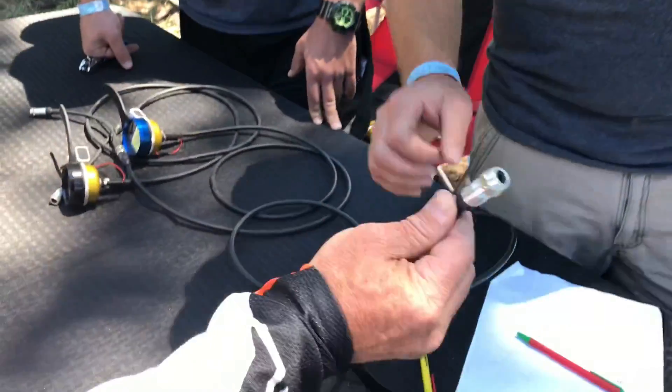The temperatures just skyrocket and you won't make it home. A lot of people can stop there and do a quick belt change — you're not pulling strands out of your clutch. Hopefully you didn't do engine damage when your belt broke, or clutch cover damage. We see that a lot with snowmobiles — people lose their motors, they blow a belt, and the next ride they lose their motor. They don't correlate the two, but that's what happens when those belts break. All that tension stored up in that belt releases, and those motors can sometimes hit 15,000-plus RPMs — they way over-rev.